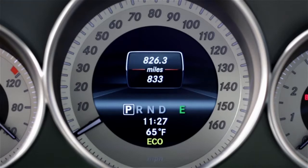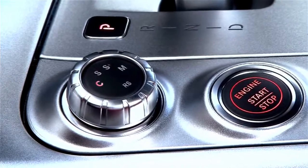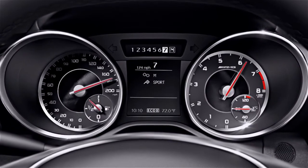And the engine will stay running. On AMG models, you must select program C for the automatic transmission. The special AMG menu in the instrument cluster also shows a message saying Start Stop is either active or inactive.